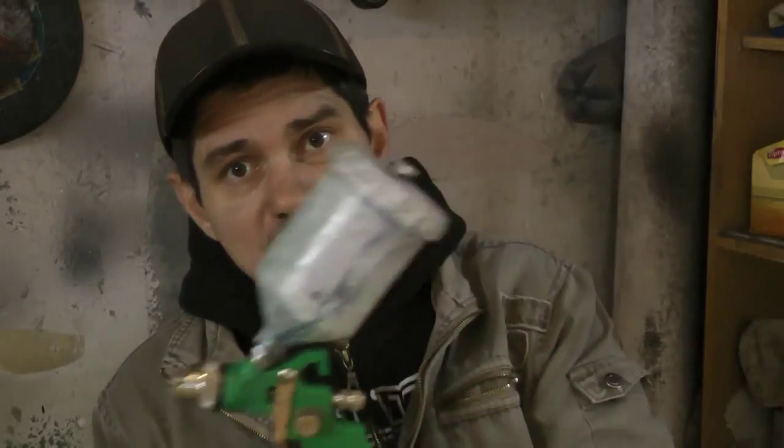What kind of spray gun should I choose? I use China-made spray guns. This one I use for primer. I used to prime with a 1.7 nozzle, but nowadays it seems unnecessary. I prime in not very thick layers with a 1.4 nozzle and mix the primer making it slightly more liquid. What I have here is an HVLP spray gun — though I will not claim it really is HVLP. The nozzle here is also 1.4, so I paint with it as well. I use these spray guns.